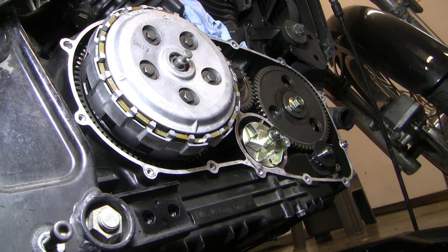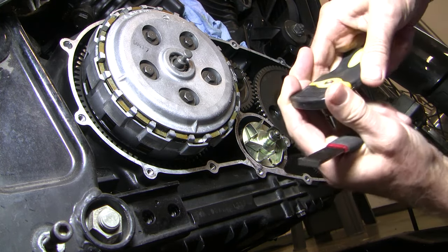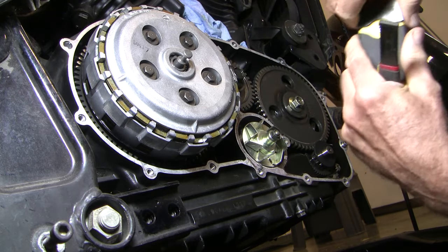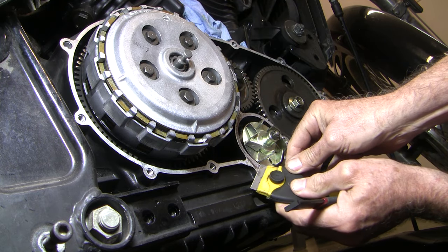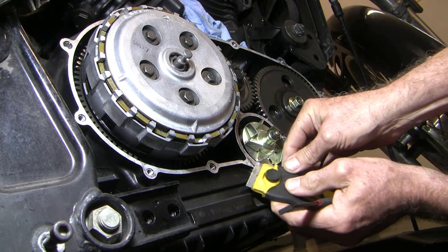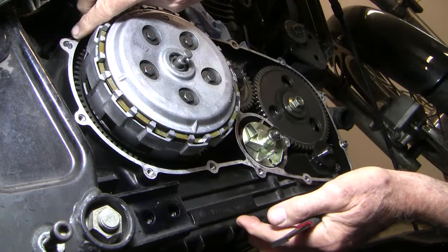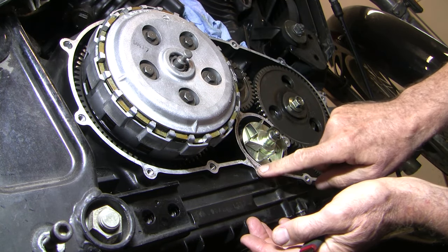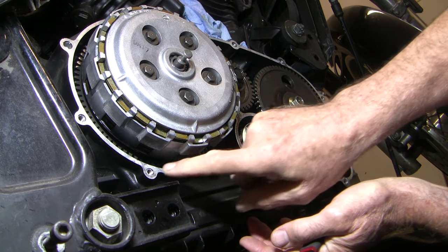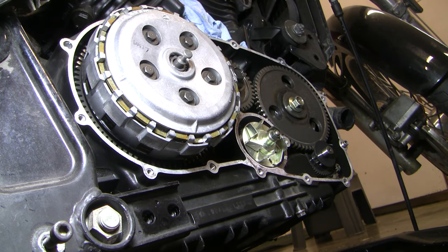This next part is just painstaking. Using a carbide scraper and a razor blade, go around and scrape all the gasket off as best you can. The case is aluminum so you want to be really careful. These actually look like helicoils to me — it looks like Kawasaki decided that just using the aluminum case for the bed of the threads was not good enough. They put helicoils in all these bolt holes, which is a good design feature because otherwise you could end up with stripped threads.